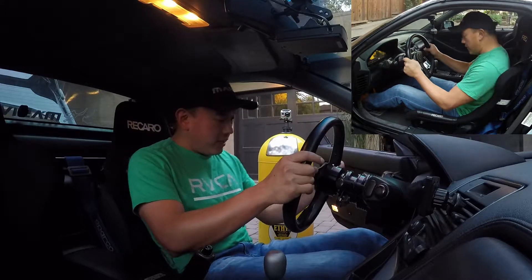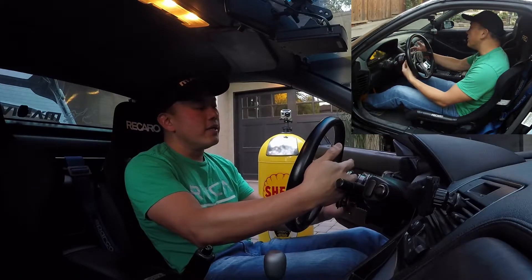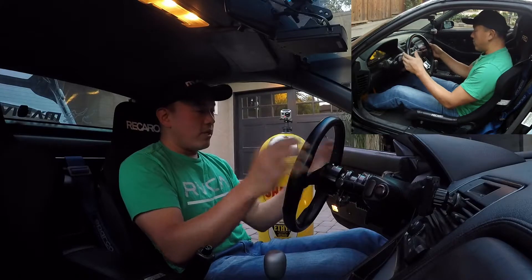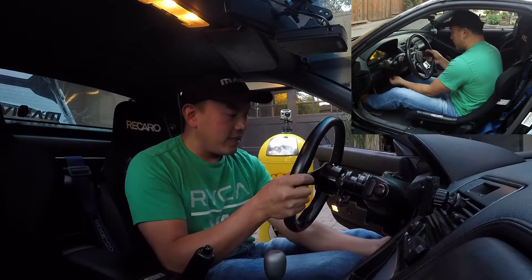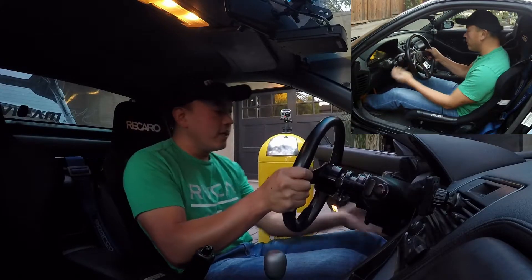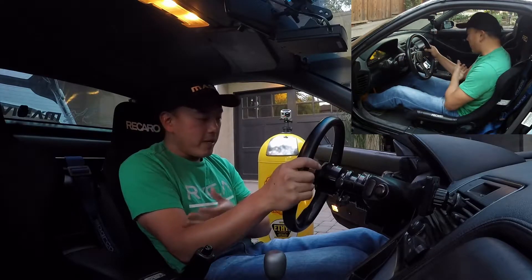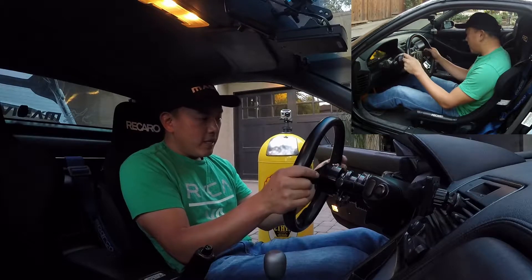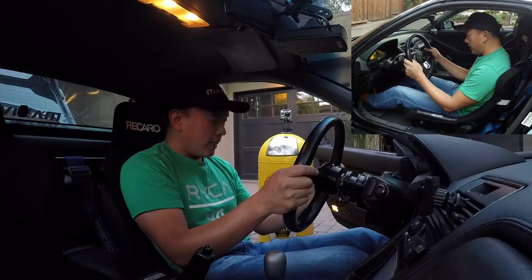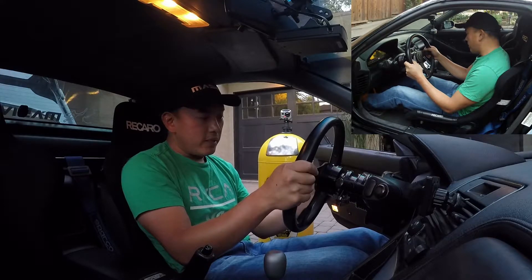As far as the rest of the seating position, the arms are probably the next most important thing. I actually had to extend the steering column another inch from where it was because I wanted the steering wheel closer to me. On the NSX it does have some adjustment — fully up, fully lowered, and also telescopic. Even at full extension I want my arms to have some slight bend, which makes it much easier to turn the steering wheel and gives much more precise control, and also much more leverage especially with manual steering.